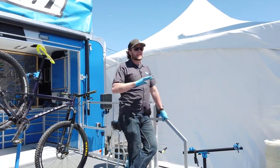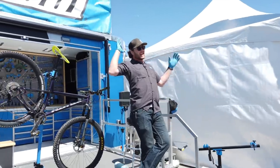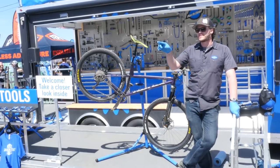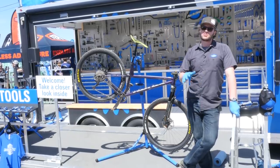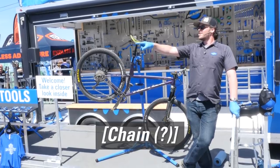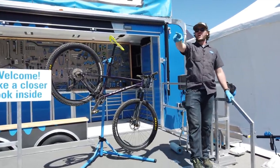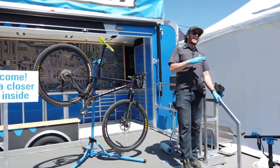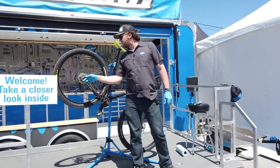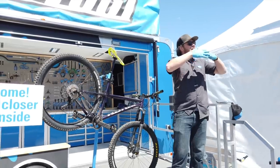You can't get to the bottom of it — you've rebuilt your bottom bracket, put retaining compound in there, brought it to the bike shop. It only happens under load, it's close to the sprockets, and it happens after like 10,000 miles sometimes. It's the driver — the freehub body that the cassette is mounted onto. It could be dry, and the pawls are creaking because when it's camming over in there, it can actually cause a creak. It's not always the bottom bracket.